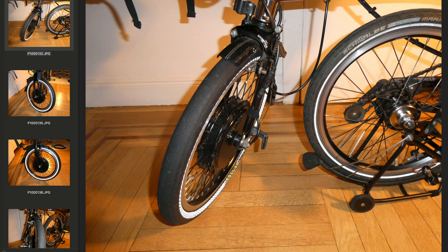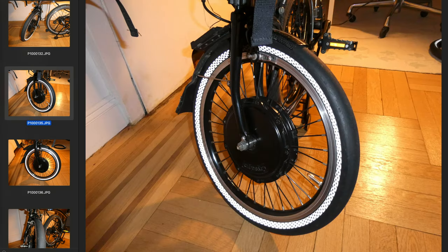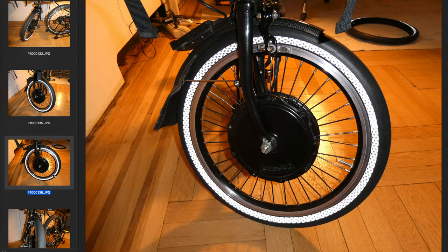It worked just fine — I could even use the mudguard, so no problem. You can see the front is a bigger tire but not dramatically so. I run it at 40 to 50 psi, typically 50 psi, and the difference in comfort and how easily the tire accelerates is off the charts compared to the Marathon. The Marathon is a touring tire built exclusively for durability, not comfort.